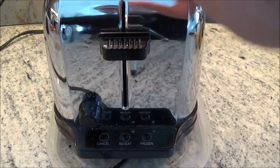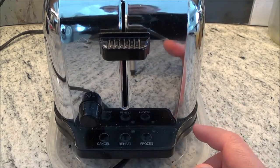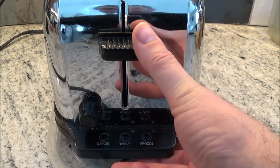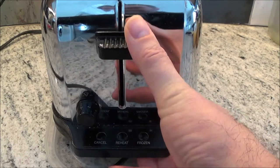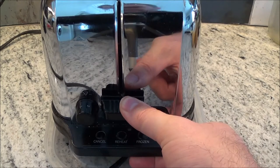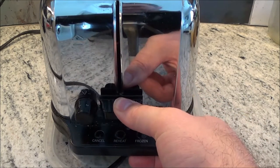We'll start the troubleshooting right now. I've never looked inside a toaster before, but I've got a pretty good idea of how it works. First thing you've got to make sure is that this thing's getting powered, because the way these things stay down — it used to be a mechanical latch, but now it's an electromagnet. So if the thing doesn't have electricity, if it doesn't have power, it's not going to stay locked down.